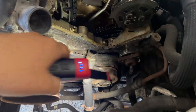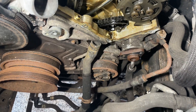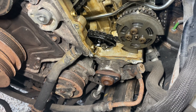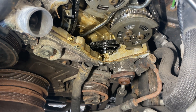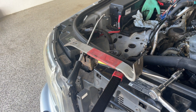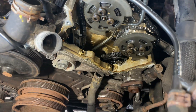Down here I've got the power steering pump, and I could not get the pulley off for the life of me. I soaked it in PB Blaster and did everything. There are only three bolts you take off and then you're supposed to be able to pry it off. You have to remove that before you can remove the cover up here. It took me three days of soaking it and hitting it with a hammer. I finally got my crowbar out — that didn't do much. At some point I looked up how much it was to replace and it was only 30 bucks.